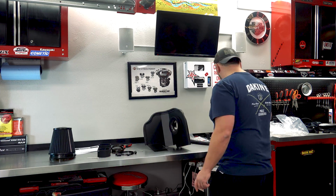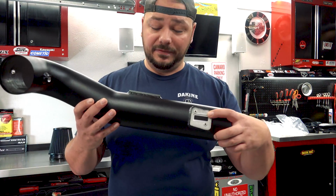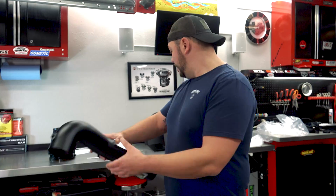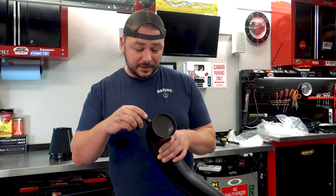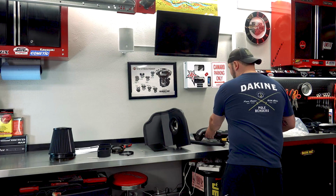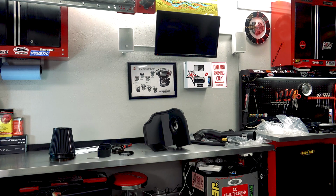So that's good. And then the next piece, your mass airflow sensor goes right there, obviously. And then we've got these two fittings right here, right across from each other, which is where these guys go. These are identical. And I'll probably see if I can get a little bit of pipe dope. Grab that right here. Or actually, you grab a little bit of this. That's just to ensure it's just air, so I'm not overly concerned. We'll thread these guys in.